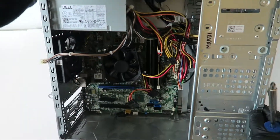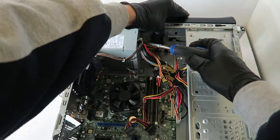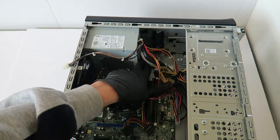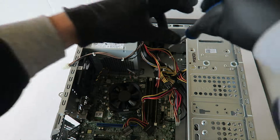Remove the four screws in the back of the power supply. It's got a secure clip — press on it to release the lock. The power supply actually has two secure clips, one on the bottom and one on the top, so you have to use two screwdrivers to release them.